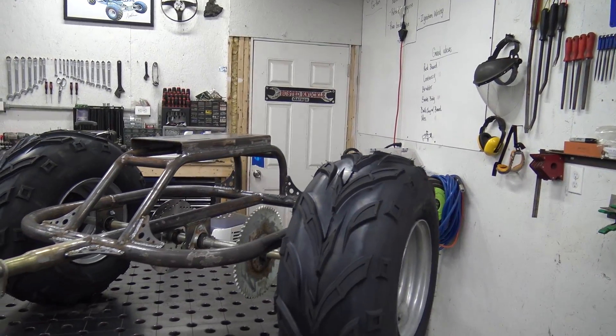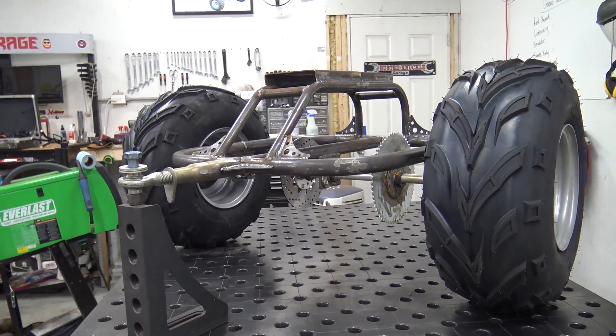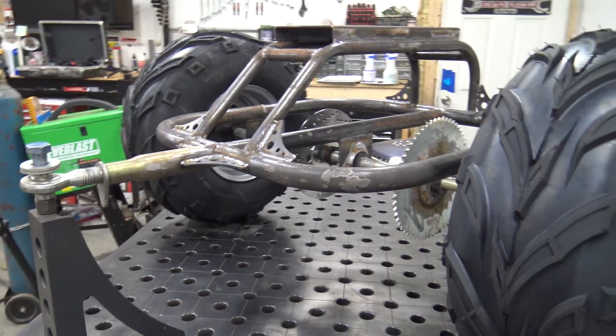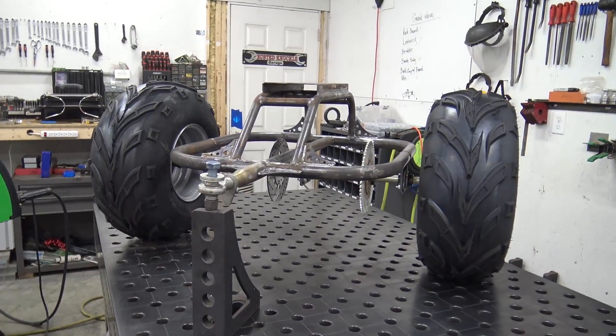On the next video, we'll mount it up to the frame, get the hoop around the engine that houses the shocks built, and mount the gas tank from Brad Hill. I think this thing is going to handle awesome — just like the Deuce, probably with as much suspension travel. We're using 150cc style shocks, keeping it all 150 GY6 style go-kart parts. I really like that engine riser being so aggressive; it adds a lot to the swing arm. The reason we did the engine riser so high was to make sure we had clearance for the brake. Those brakes have a parking brake fixture coming off them that can get in the way, but it looks awesome.